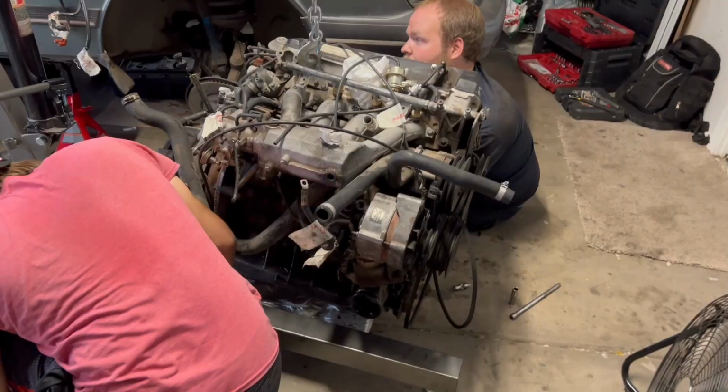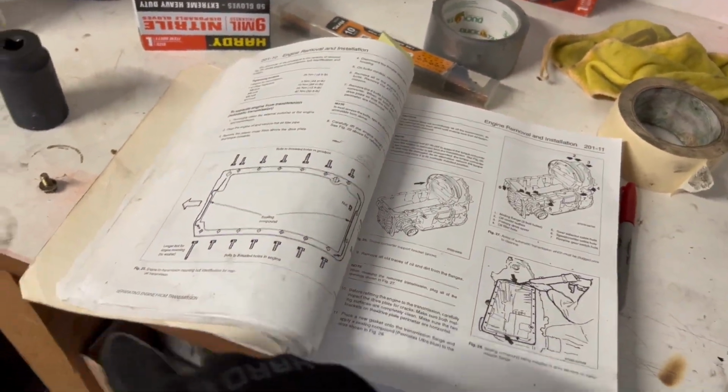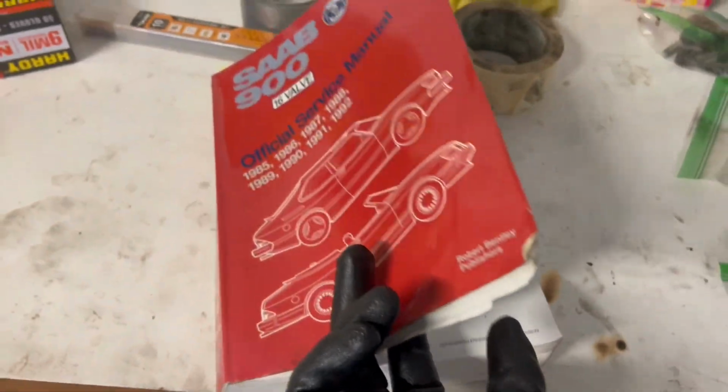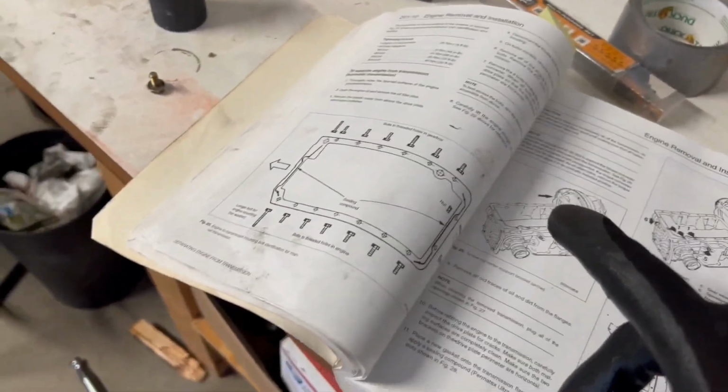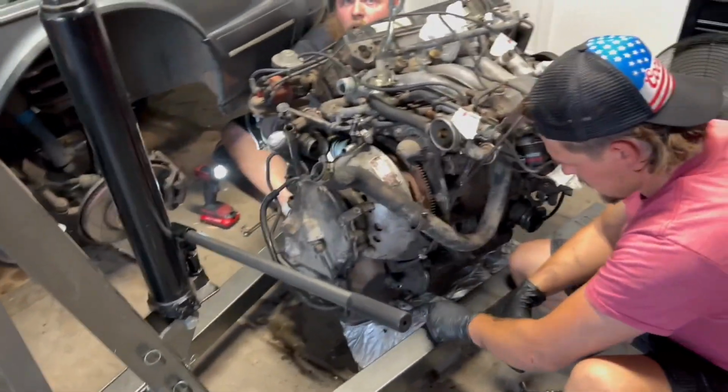I mentioned this in my last video, but a subscriber sent me a Bentley manual for the 900, which is super generous of him. So we're using that. You can see all the bolts here, and the interesting thing, which I noticed at the yard when we pulled it out, is that some of them are different lengths. Here we have the diagram, so we know exactly where the long ones go, which is super helpful. We're pulling off the last couple, and hopefully we can break it apart.